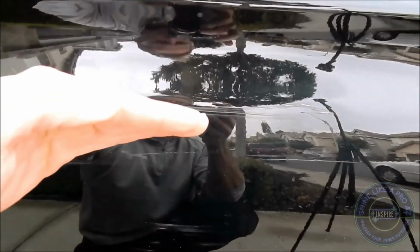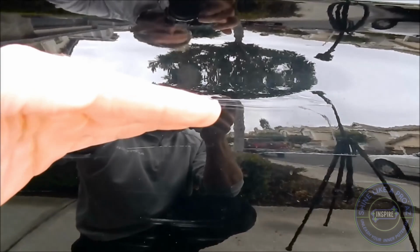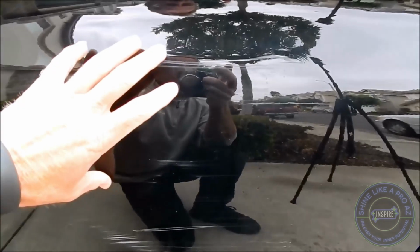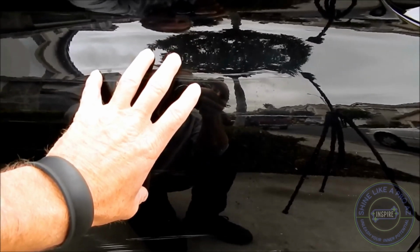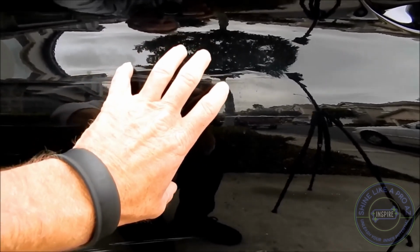So you basically start with the top layer and work your way down. So I can remove the transfer and then it will reveal the scratching. Then I have to determine what can I do about the scratching. The first thing, as a rule, and there's always exceptions to the rule, is that I'm going to deal with the scratches through the process of wet sanding and polishing before I apply touch-up paint of any kind. But like in every situation of life and detailing specifically, you always check and verify and then respond according to the specifics of the situation.